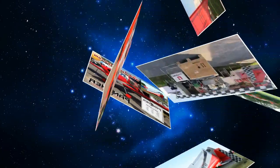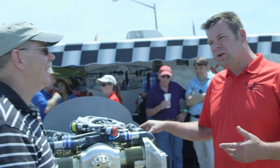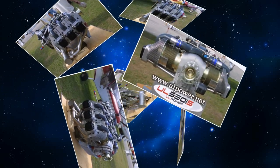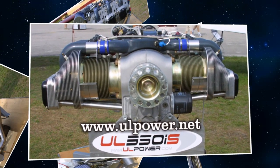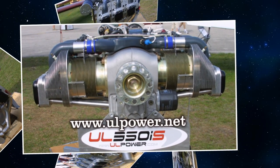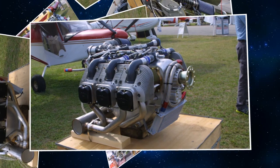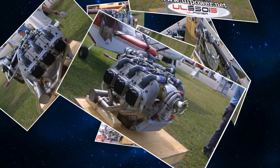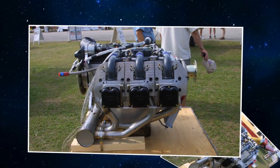Tell me how you're going to work with these guys. This is a 350 IS — it's about 115 to 130 horsepower engine. When you get an engine for an airplane, you can't just plug it in; you've got to have some extra component parts. The main thing we do is engine mounts, the cowling, and most likely the baffling kit. Everything else basically comes with the UL. We offer the baffling for cooling, and there are two options — one from us and one from UL.